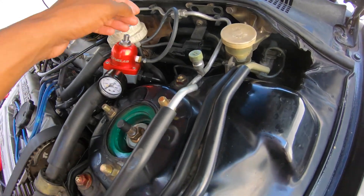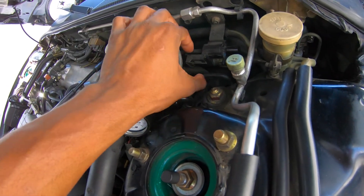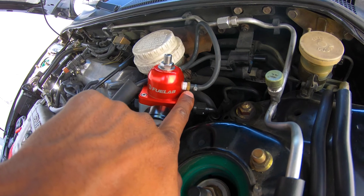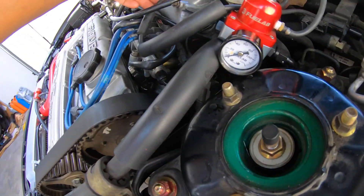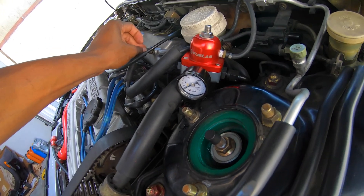A little tip we found: the tuner noticed my car was taking several cranks to start up. I told him it had been doing that since I put in the fuel pressure regulator and fuel pump. He said that's not right — turns out I had the vacuum line from the regulator attached to a stock solenoid when it should be going to the manifold so it reads proper fuel pressure. He said that's not safe when you start giving it gas — you might not get enough fuel pressure.